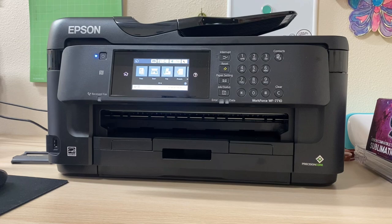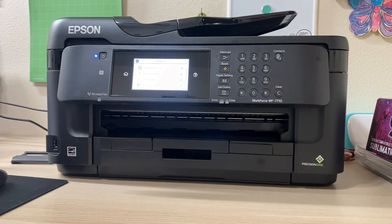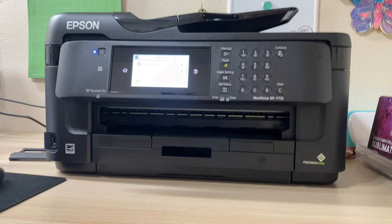If after five to seven times it's still looking wonky and not showing solid grids, do a Head Cleaning. If that doesn't work, move on to a CMYK purge image. I realized the cleaning wasn't working, so I did an alignment — that's all under Settings, then Maintenance. I did print head nozzle check, then print head cleaning back to back, then print head alignment — horizontal and vertical — and that didn't work either. So then I moved on to the CMYK purge image.